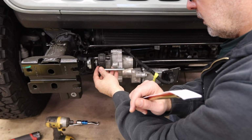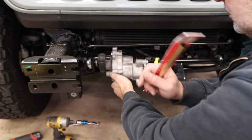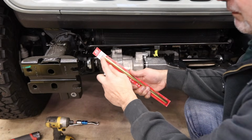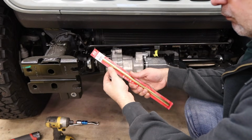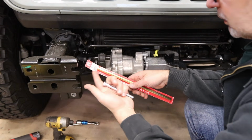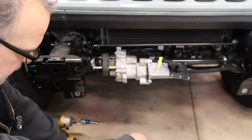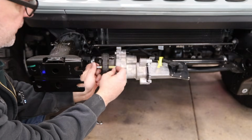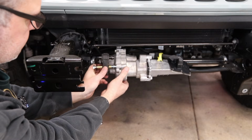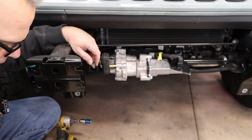You got this 100mm M10, which will go into this hole. And then I got some 7/16 by .014 round brass tube. This will sleeve it, fit in there nicely so it's not loose in the bushing. Total overkill, you don't need to do this, but I'm doing it anyway. I need a smaller M12 washer. Let's see if I got one. And the purpose, since the brass is soft, I don't want the brass being right up against the body of this. Sway bar disconnect is flipped.